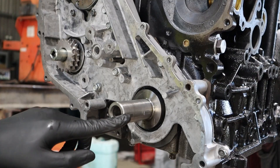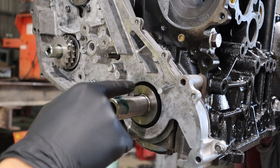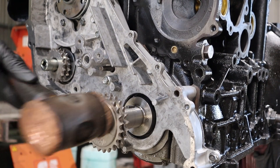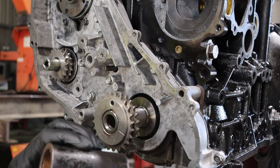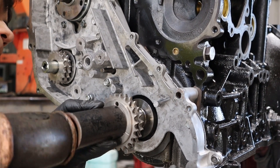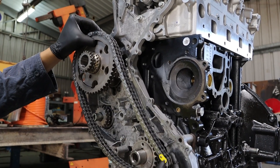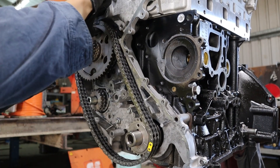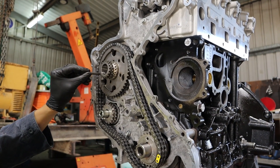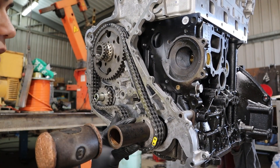Remove the fuel pump sprocket and turn the crank woodruff key to 12 o'clock. Put some grease on the crankshaft and install the crank sprocket with a copper hammer, tapping it on so it just gets started on the second woodruff key. Once you reach that point, you'll need a piece of pipe. Put the chain on the fuel pump sprocket, lining the blue link up with the dot on the sprocket and the yellow link up with the line on the crank sprocket. Hold the chain up from the bolt, then tap the crank sprocket on with the copper hammer.